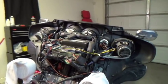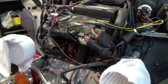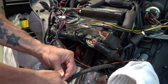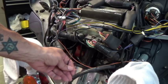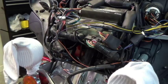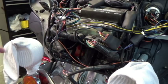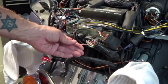Within the actual Electroglide headlight assembly, there are extra wires. Within the Harley-Davidson Electroglide light bulb assembly, there are two extra wires — the orange and black wire — and you can see them here. They're used for the European setup for extra lighting that they have in Europe; in America, they're not used. So you actually have a switched power source here that goes off of the auxiliary fuse. I'm going to use these two particular wires for my GPS connection.